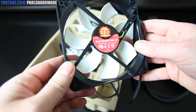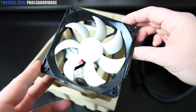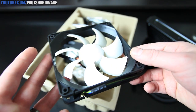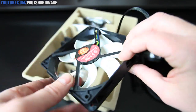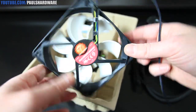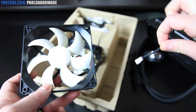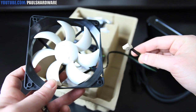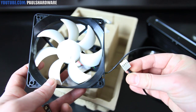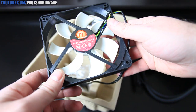You get two fans. Usually the ones provided with closed-loop coolers are decent enough and provide sufficient static pressure to move air over the cooler. By upgrading the fans you can actually significantly improve performance of the cooler itself. I'm going to start off using these — they're black and white and will match perfectly with the Fractal Design R4 case. I might end up switching them out. Four-pin PWM connector, which I always like — PWM is superior to three-pin connectors in most respects.